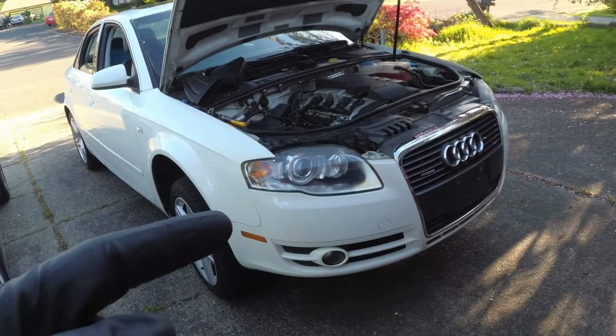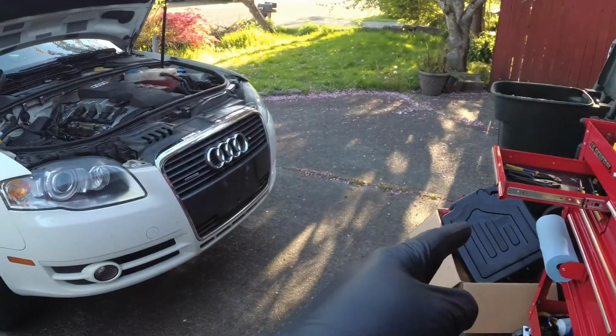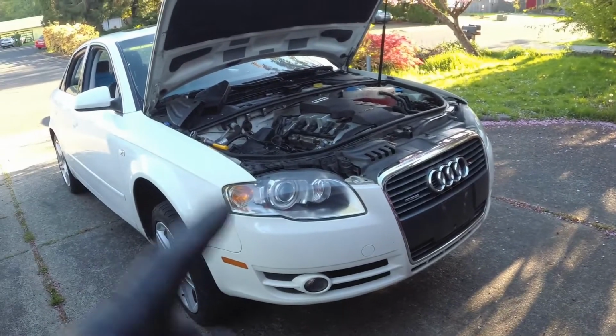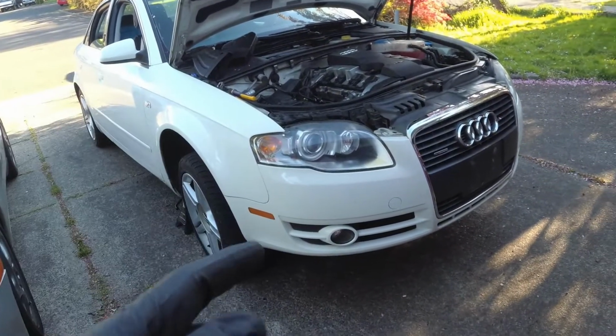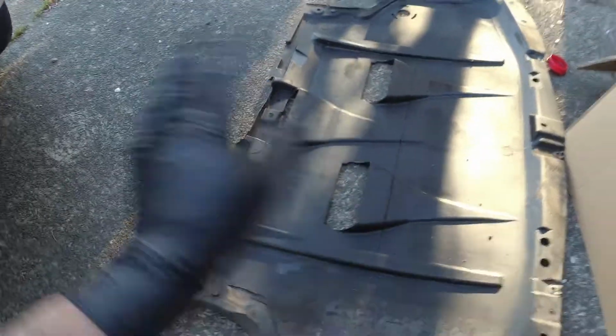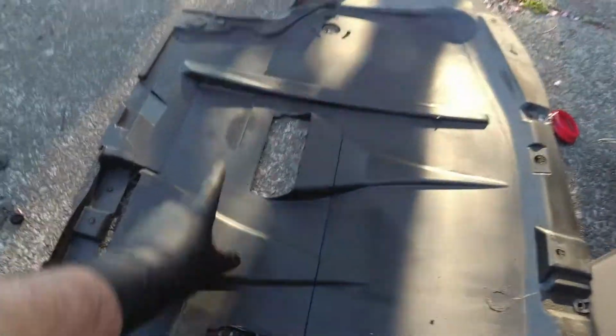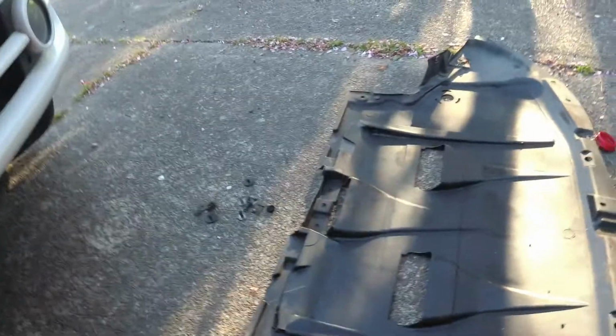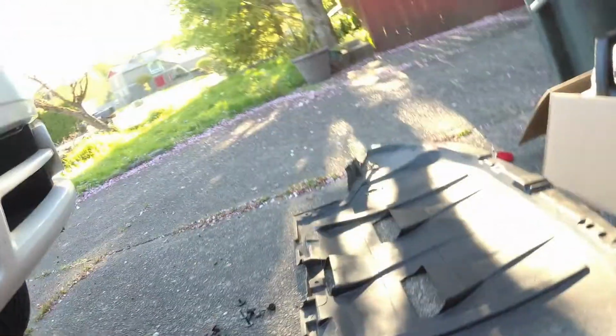We are now getting ready to slide underneath and take some oil out and see what we get this time. So, I'm going to take off all that under panel stuff and slide under there, and then we'll come back to the action. Alright, got that under tray off, and you remember the other day when we cleaned it all up so we could tell what was happening with the leaks? We got one little wet spot right there is all. That happened in a week's worth of driving. And this thing is a commuter, so that is a lot of driving. And underneath here, you can see we've got some weeping.